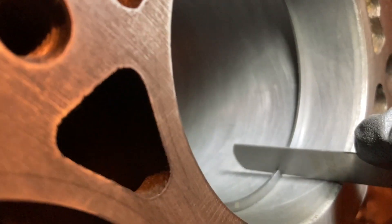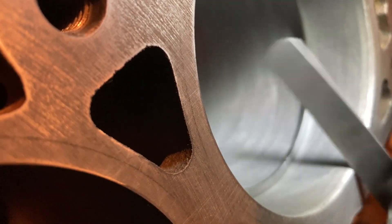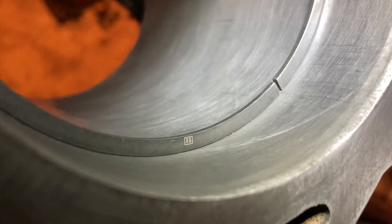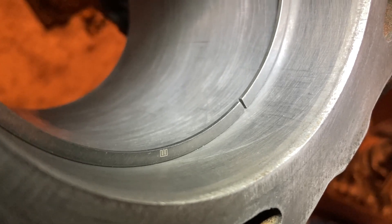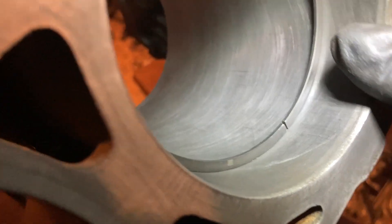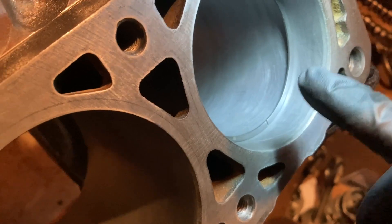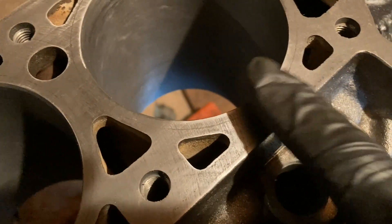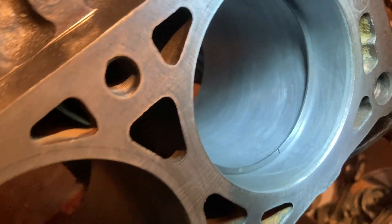Filing it out to the right size: a 28-thou feeler fits in there nicely. I don't have a 29 in this set, but I've got a 30 — the 30 fits but gets a little caught, so it's slightly too tight. You can see the Moly symbol — these are Moly Clevite rings, symbol facing up, groove facing down; that's how it'll be installed on the piston. I'll do the same procedure for all five other cylinders, each top and second ring fitted specifically to its own cylinder and piston.